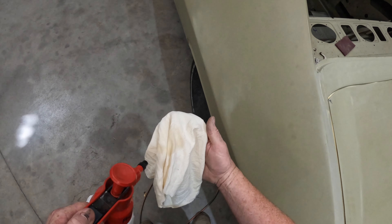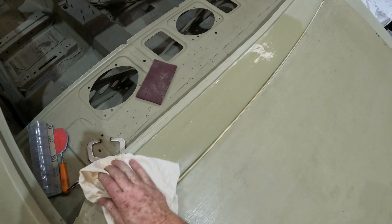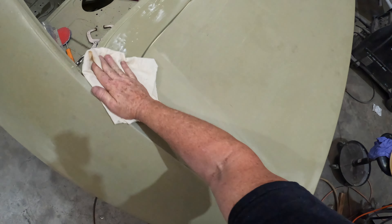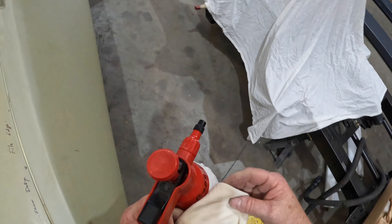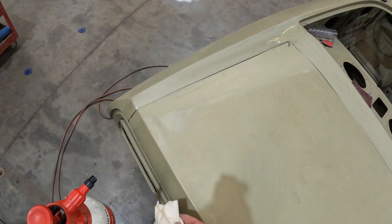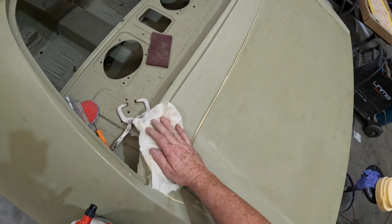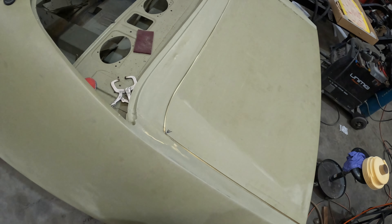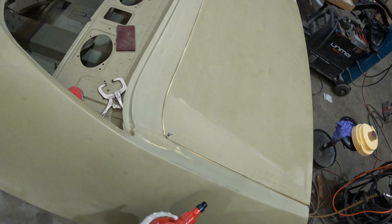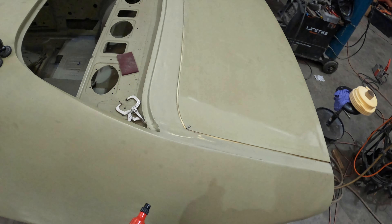I'm not going to pretend I'm doing stuff I'm not doing. I wish I was so good that everything here just required a skim, but I'm simply not. I'm not too bad with the engineering side, but not particularly crash hot with panel beating — I lack a certain amount of knowledge and a hell of a lot of patience. It's not completely planished perfectly. The reason this wasn't is because I wanted to weld and planish everything in situ. I knew that if I took it off and started playing around with it on the bench or with a planishing hammer, I'd probably come back with a totally different panel — even though it may look good, it probably wouldn't fit because of all these curves. So I just wanted to leave well enough alone.